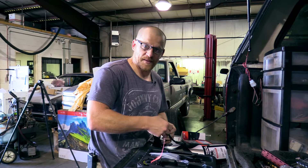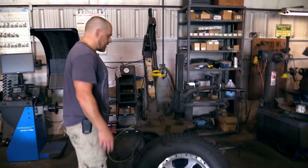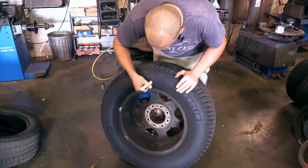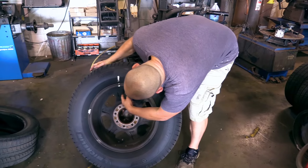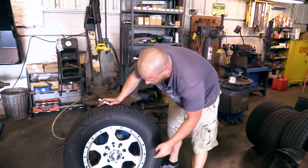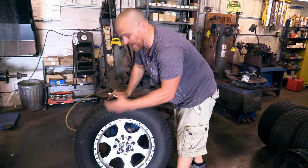Rather than me spending time in the owner's manual reading how to use this, I'm going to have my brother show us. The plan is I don't want to balance this tire because my brother doesn't have the right adapters for my rims. So I just want to break down the front bead. I'm going to mark the location of my tire and rim just in case, so they don't get messed up. As long as we don't take the wheel weights off and put the tire in the same position, we should be okay. The new sensor might weigh slightly different, but I'll deal with that later.